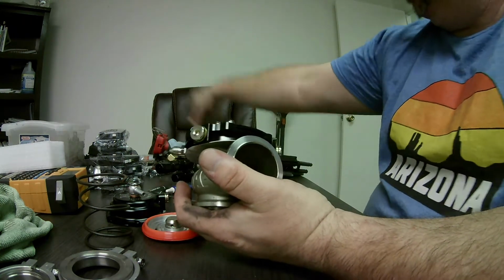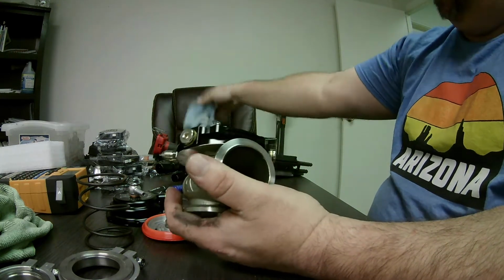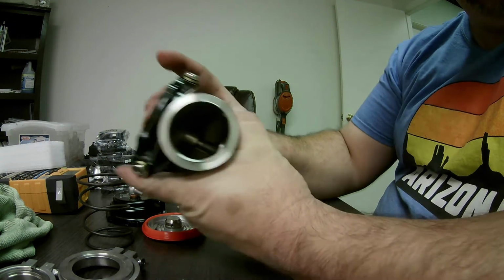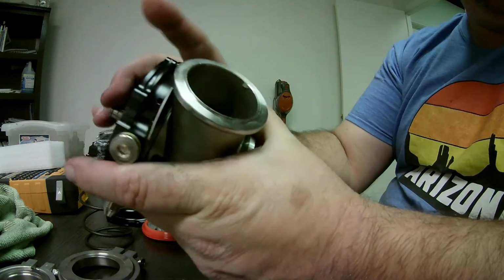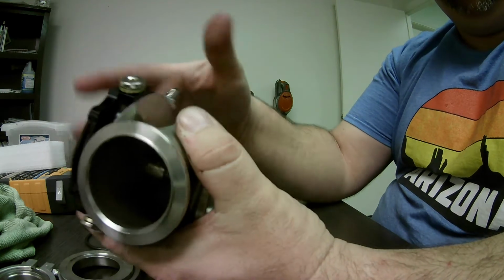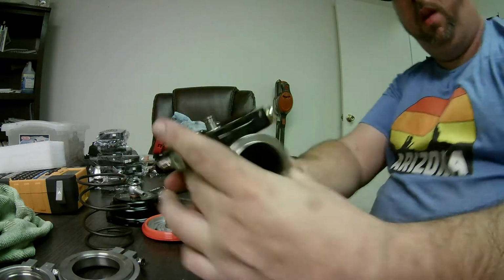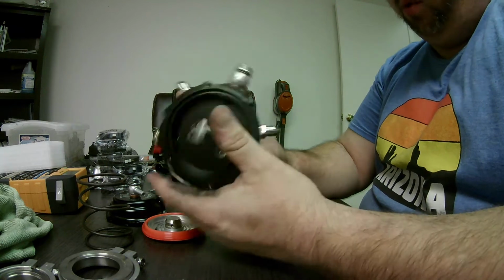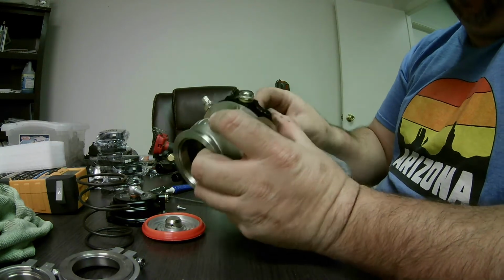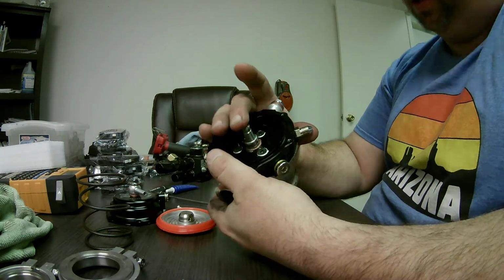Okay. Wipe the grease off my finger. All right, now let's see how smoothly it runs. So we get some grease up in there. Look at that. Almost here, absolutely no abrasion. I mean, it just rolls right in and out pretty smoothly. So that is a very important thing to do on these wastegates, whether it's real or a replica or a counterfeit or whatever you want to call them. Make sure the shaft slides nice and smooth with no resistance.